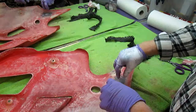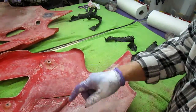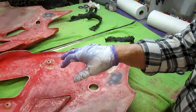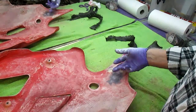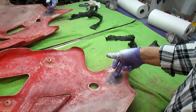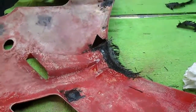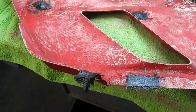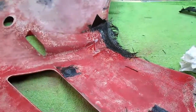now I'll do that to all of the parts that need reinforcement. There's 1, 2, 4, 5, 6, 7, 8, there's 9, 10 of them. No sense showing them. They're all going to be very similar to that. Then when we do the cosmetic work on the other side, we'll burn that hole through with a Dremel tool. Now it's definitely a messy job to do this, but boy does it add insurance that you're not going to have a problem in the future.